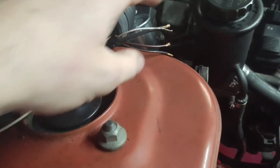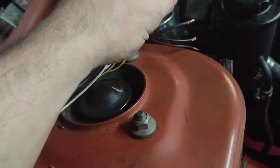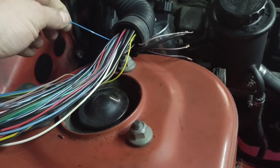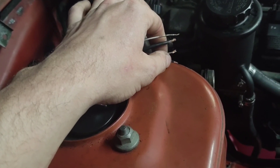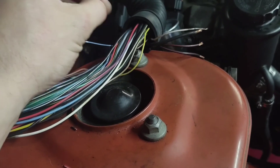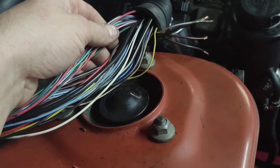I've already got a couple of these pulled out. They're all going to end up cut at this exact length, but there are a lot of wires so I don't want to get lost. These ones are going to hot — I think these are all powers. This one goes to the dash for coolant temp. But I'm going to put ends on all these, put them in a connector, and then cut each of these one at a time so I don't get lost — put an end on each one, put one in the female end, one in the male end, and hopefully I don't mess up.